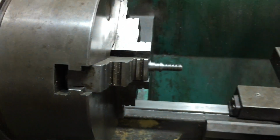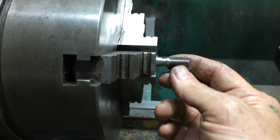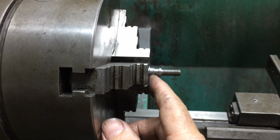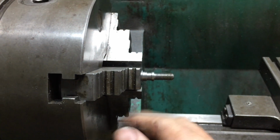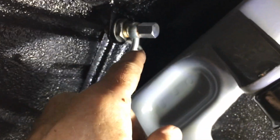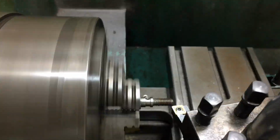Those cables I bought, they don't fit. The rear brake flexible hoses, they're just too skinny. The bit that bolts at the end of it, so it just won't tighten up. I'm going to have to shorten that by a thread or so. Anyway, I'll shorten that, now it's tight. You probably can do it without a lathe, but I've just got to do the other side now. I've just got to shorten this one.